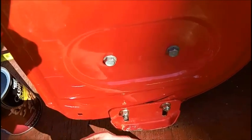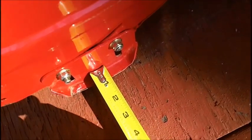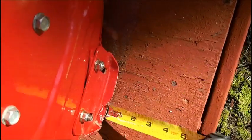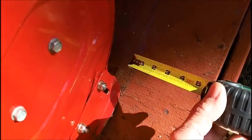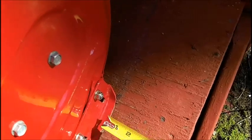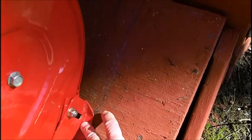If they came out to like here, I'm estimating about a 1/2 inch. If those skids were like 2 inches wide, they came out at least 2 inches, fine. Now, I can get the flat stock. It's about $8 for a 3 foot by 2 inch wide, 1/8 flat steel at the hardware store today. I just looked. But the only way I'd be able to mount it on here is to drill a hole here and here and bolt it in, and it's gonna flex and come right off.